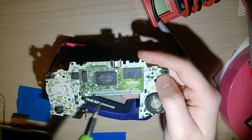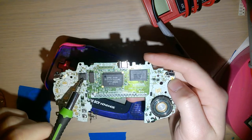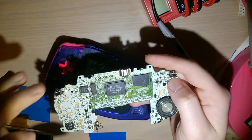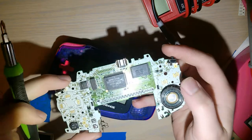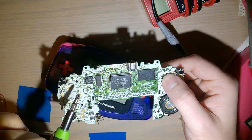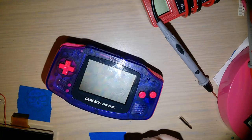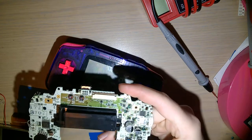On the 32-pin version you'll just see three chips: the SRAM, the CPU, and the Crystal. This extra chip on the 40-pin board is responsible for powering the 40-pin screen. I've looked at the schematic but I'm not fully familiar with it. I believe this chip is responsible for making the console use more power overall.